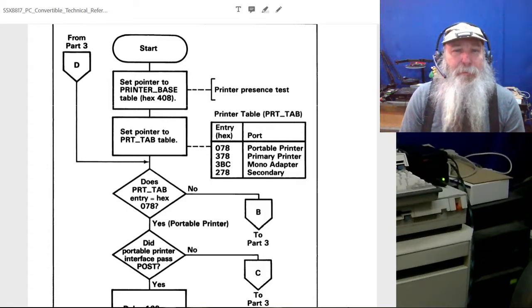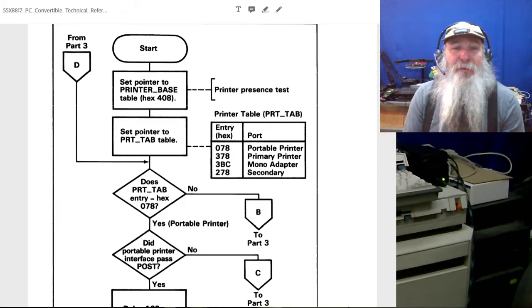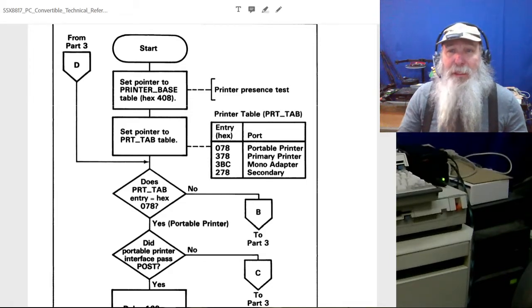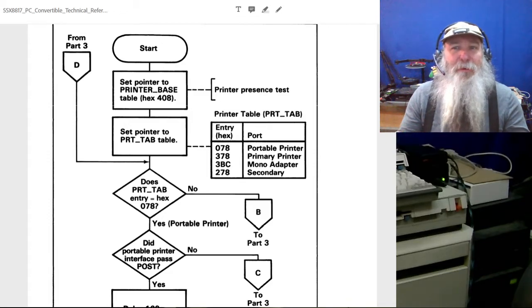But seeing the listing here, it does list things like mono adapter. Well, the PC Convertible doesn't necessarily have a monochrome adapter that had a parallel port on it. But there's a couple other addresses. And going through these flow charts and talking about checking if there was more than one serial port or a parallel port at both the 378 and the 278 address, those slices are not adjustable in any form. The only way, since you're not able to put any other adapter on the PC Convertible, for two parallel ports or two serial ports, aside from the internal modem and that portable printer on the back,